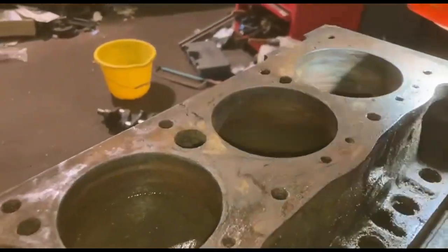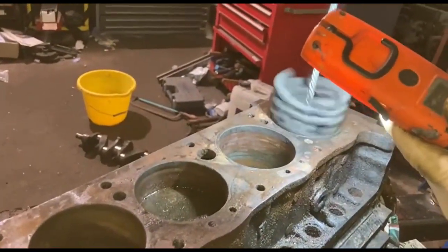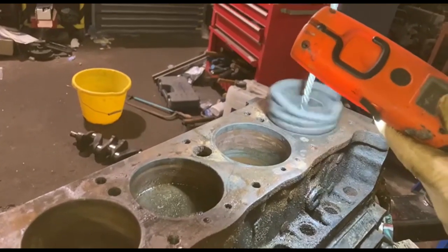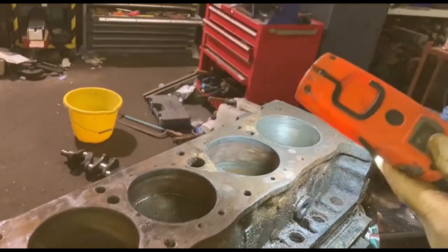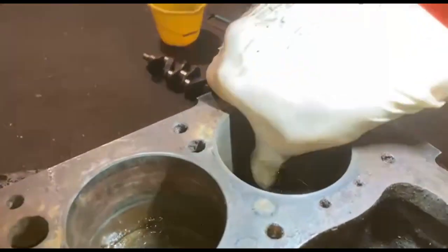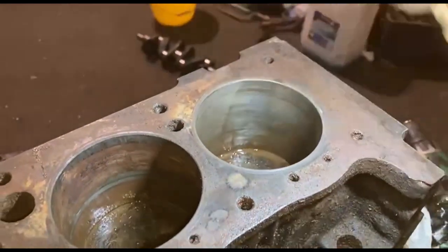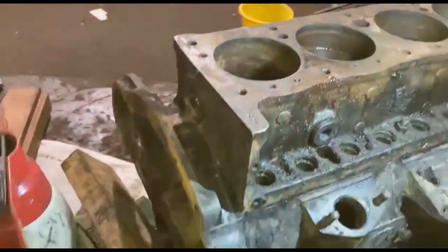Clean that round and then use this hone. Now you can see that's cleaned all the rough sheet off. I can poke the piston back out — I'll do that on these three, knock them out, and then put this one in the press.